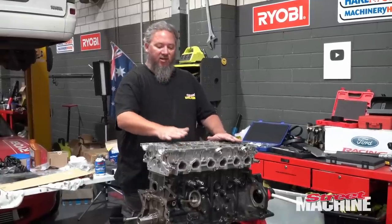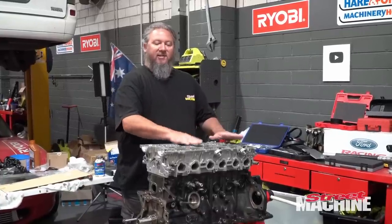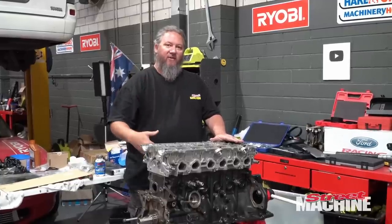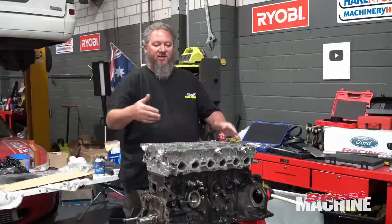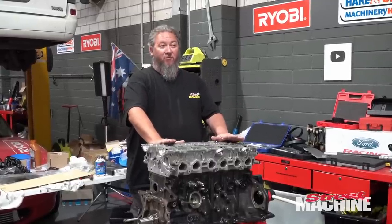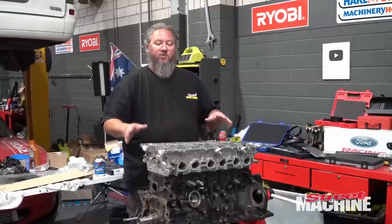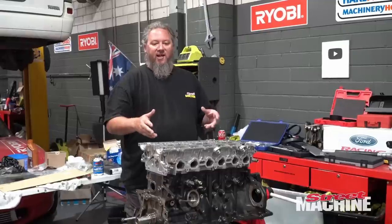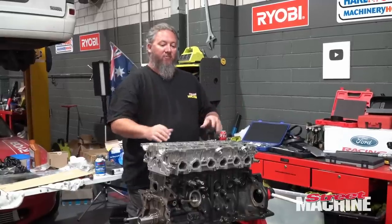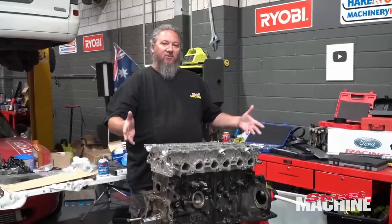I mean, this head was reconditioned and it's set up with valve springs, the whole thing. So to start afresh would cost us serious money. We'd have to buy a new exhaust manifold because the manifolds are different, and a new intake manifold because the GE intake manifold is different. We would have to spend probably the best part of $5,000 on all new manifolds and springs and that sort of thing to do the 2JZ head. We already have a 1JZ head and 1JZ manifolds, so it's a lot cheaper for us to put this 1JZ head on a 2JZ block,